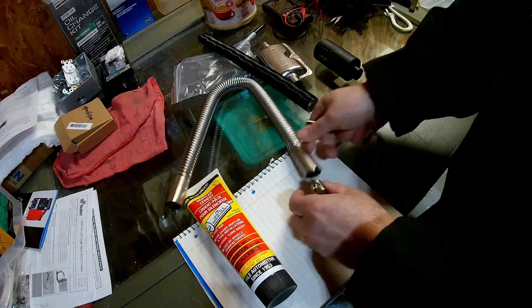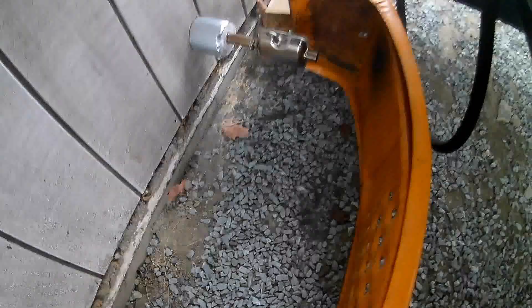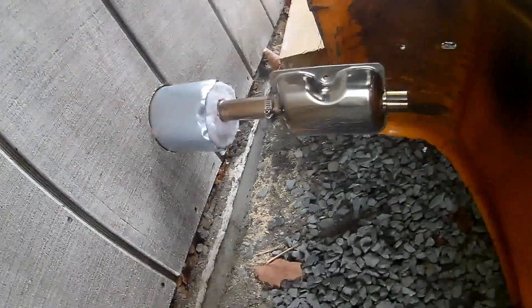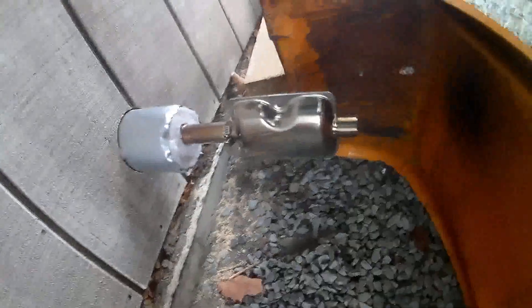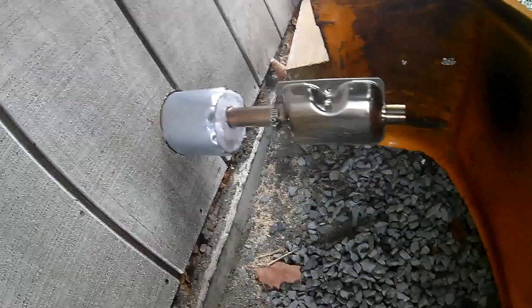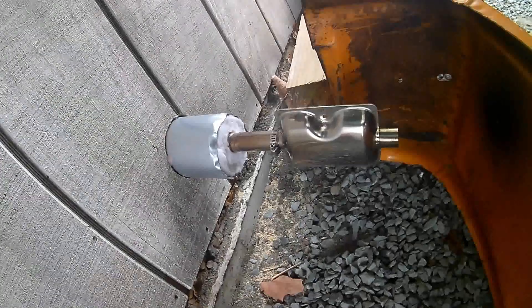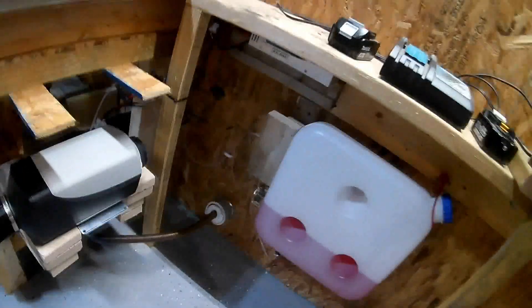Let's take a closer look at the install. Here's my exhaust setup outside. I set this up over winter — I wasn't able to move my log splitter, so I put a vehicle ramp in front of it to protect the pipe and hydraulic lines from hot diesel fumes. You can see the exhaust is oriented downward, the weep hole is down, and I've got a double-insulated pipe with ceramic blanket on the inside to prevent the wall from getting hot.